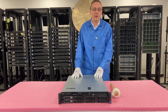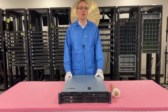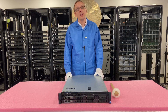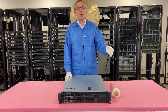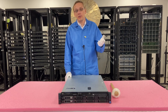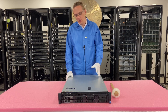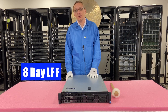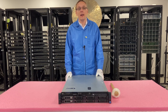We're going to go over the different types of chassis for the R530 and there's only one — it's kind of crazy. When you look at the 13th generation as a whole, there's always multiple chassis options. The 430 has a small form factor and a large form factor. The 630 has an 8-bay, a 10-bay, and technically a 1.8-inch option that's kind of a unicorn. The 730 has a small form factor and a large form factor. With the 530, I was actually surprised when we delved deeper that there's really only one option — it's the 8-bay large form factor. There is something known as a 530 XD, also kind of a unicorn and very rare, that has a 12-bay large form factor, but you just don't really ever see it.